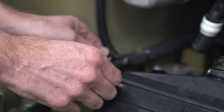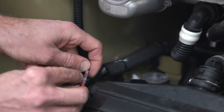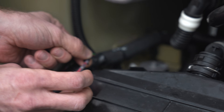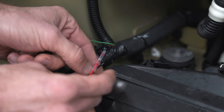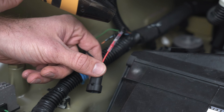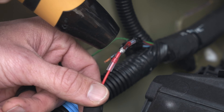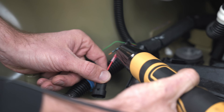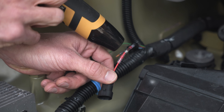To do this, slide the heat shrink solder joint over the wire. Push the two wires together until the inner copper-colored and silver-colored ends of the wires pass each other. Next, align the solder joint within the splice connector over the exposed wire so that when we heat this wire up, that solder is actually going to melt into the exposed wire itself and create a solder joint. Now bring the heat gun in — we're going to have to get this pretty warm. Watch until the solder joint in the middle actually melts and flows into the exposed wire. It's really important that we get this hot enough that the solder fully melts and wicks into the exposed wire — this could take a minute or two. Watch carefully and wait until the solder actually flows into the wire.